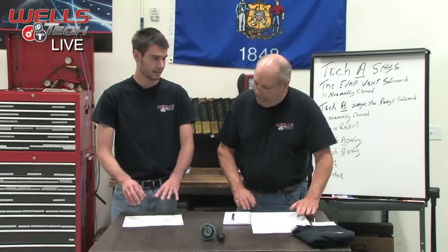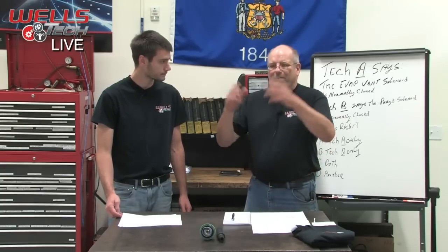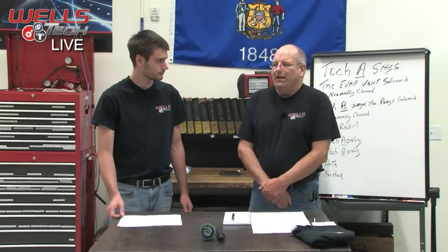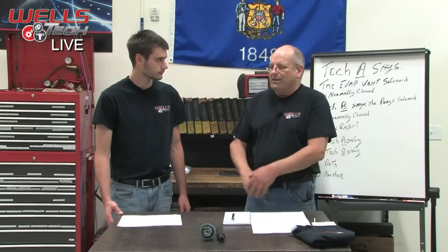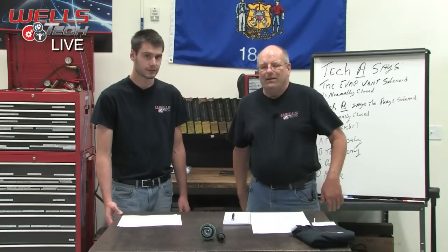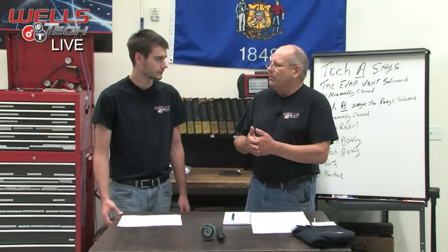So it takes all those aspects to run this test. If you have a skewed sensor or you have a fuel tank that's not the right level, it's very hard for the vehicle to run this test. And it's actually one of the hardest readiness monitors to set. There's a lot of different theories on how to do it exactly. But one of the things that we found out is that it could take 6 different drive cycles, and it has to be a 17-hour wait between each drive.